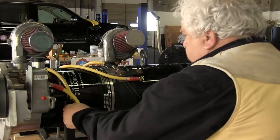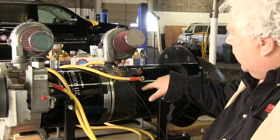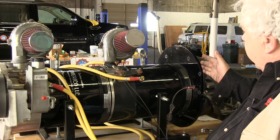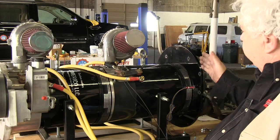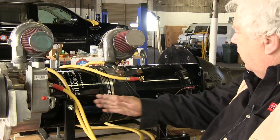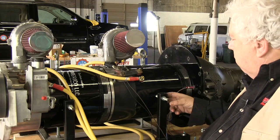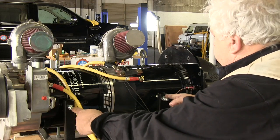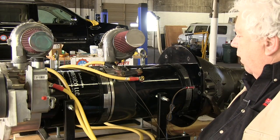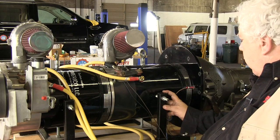I would point out that we're mounted with some 1/2-inch bolts here, midpoint in each motor. Our engine mounts that I was showing you on the Escalade fall 13 inches in from here, which is right about here, sort of between the 2 motors. We would fashion a bar that went this distance and had these bolts into the side of the motor and then connected here somewhere to the engine mounts. And we're going to have to do some further work on that.